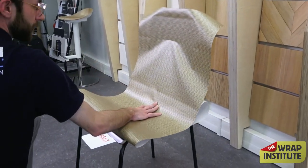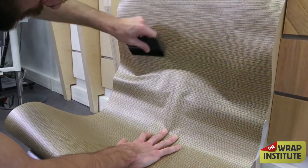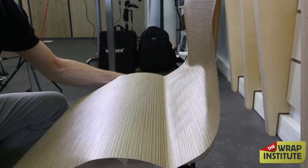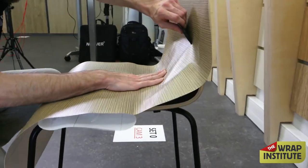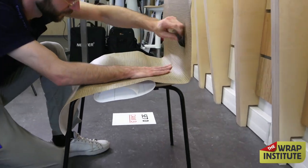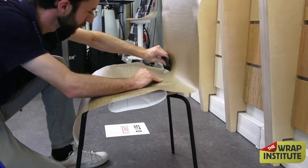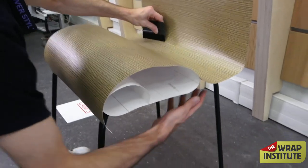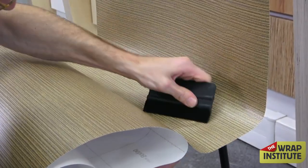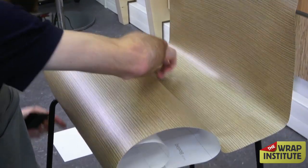You really want to make sure you don't pick up too much of the liner at one time and let it tack on the surface. Notice that nice triangle shape — always squeegee out from the middle in strokes, following that triangle shape. He spreads the material out keeping the backing paper on, really feeding that transition from the vertical to the horizontal. The backing paper acts like an extra set of hands, taking off just enough to work each section.